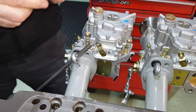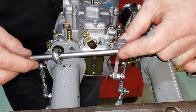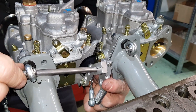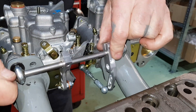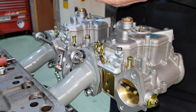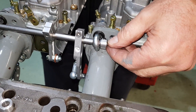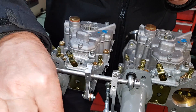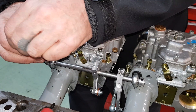Start the pivot bar through. You need to fit this one on this way round. As you're pushing it through the second rose joint, make sure you slip both of these along, then locate it through the next rose joint. Now put one bush on, pull the shaft to the end, and use a little Allen key. Then fit the other bush to the end and use the Allen key again to lock it up. That locks the shaft between the two rose joints.